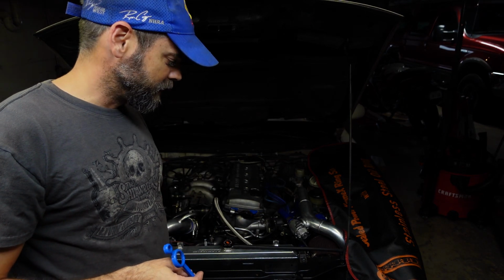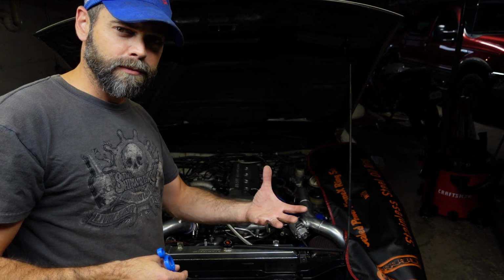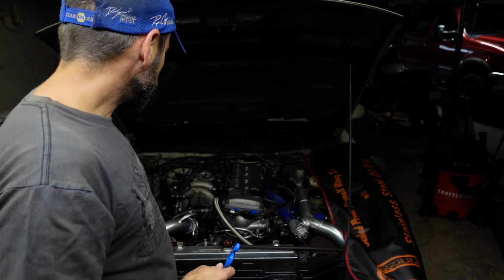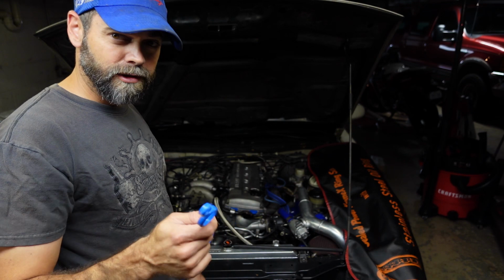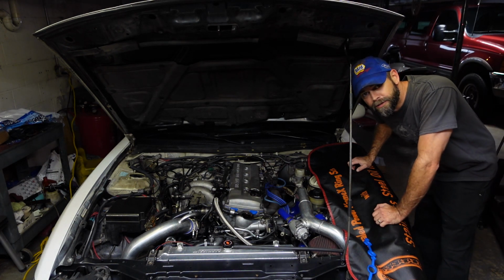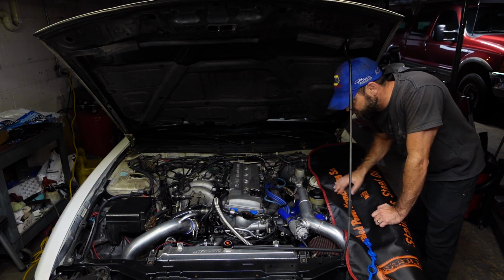So we got some oil in there, probably causing us not to spark or fire in that cylinder once engine vibrations pick up, which is why it was only doing it under certain RPM loads. We did have a problem though with the barometric pressure switch over there, as you saw in the other episode. So we're just trying to clean everything up so that we can go back out and tune it again. I'll bring y'all along while I get the valve cover off.